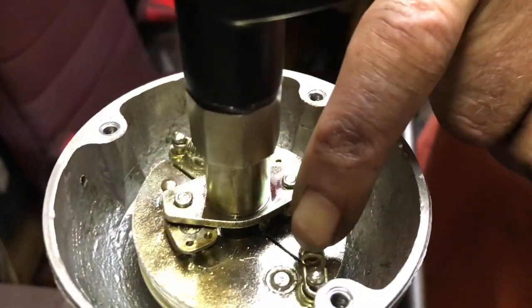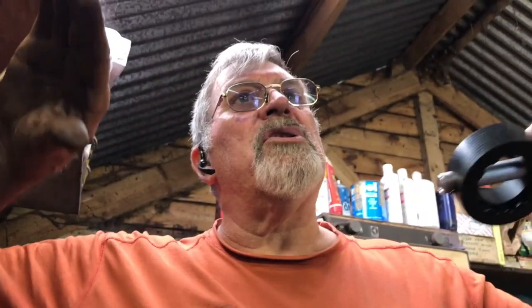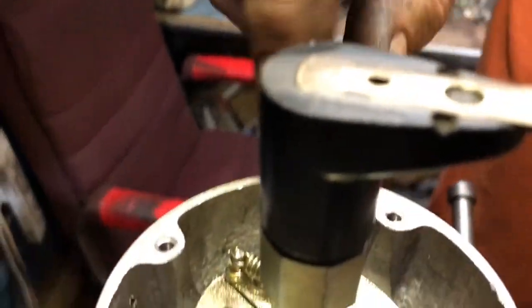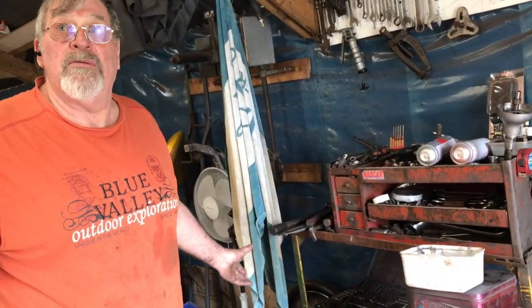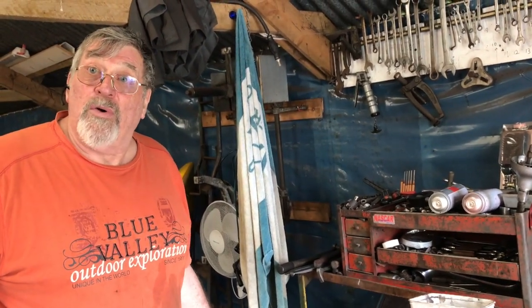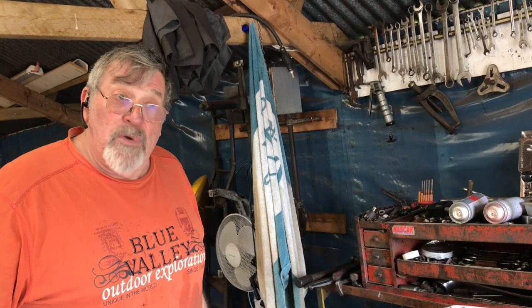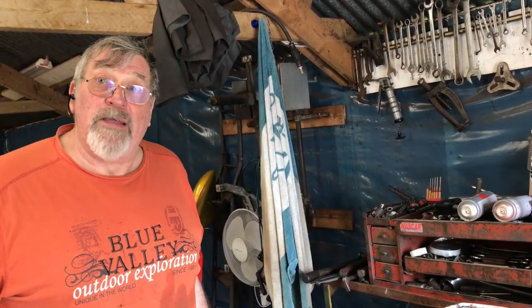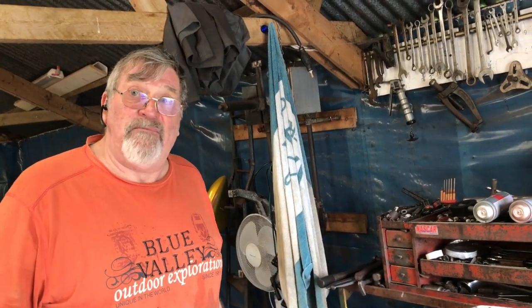The little bronze bushes are mounted in the bob weights and they wear, and instead of the bob weights going out in a centrifugal plane, they go up in a banana shape and they chatter — so the timing goes back and forwards on the engine. I hand-make all those to get the right tightness. At 3000 RPM or more, that centrifuges the carbon out of the oil so you get good oil through to the big ends, but it deposits the carbon. That's why I suggest always 3000 miles maximum for an oil change, ideally once a year, because oil does actually deteriorate — it's the additive package that deteriorates, not the base oil.